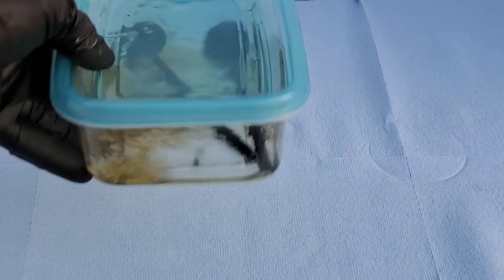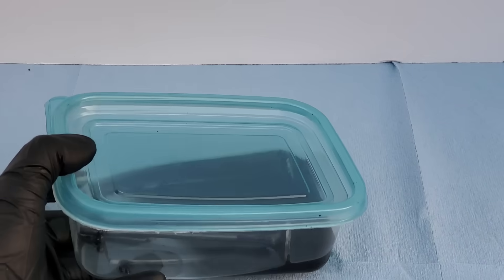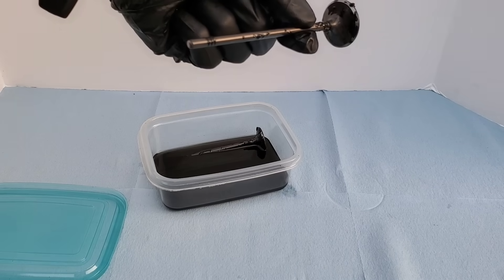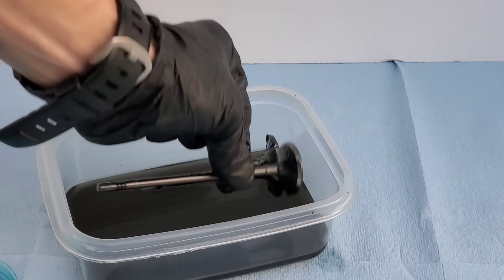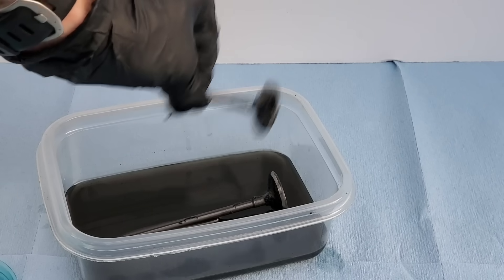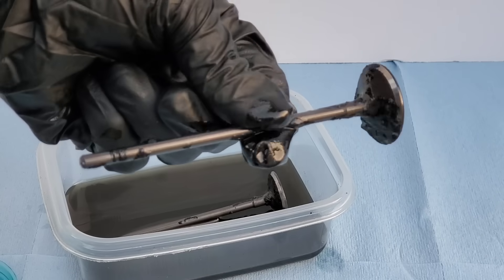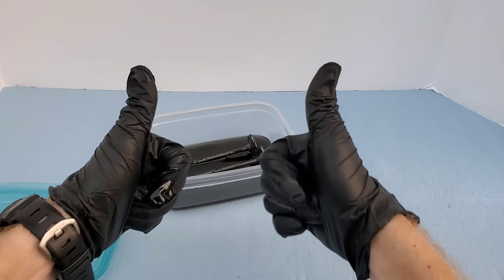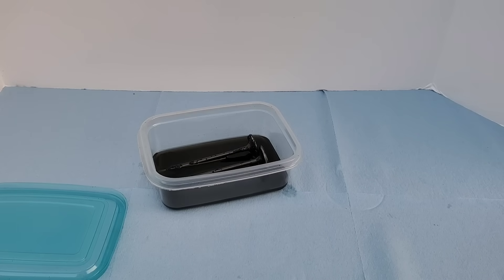I'll shake the valves up again now that they've had plenty of time to sit — I allowed it to sit for a day and placed them in the sun. Moment of truth. Oh wow — it actually did make a difference. Granted, it didn't remove everything, but for the most part — and I'm telling you, this carbon was on here bad, very thick — incredibly, it removed it. Those hard problem areas: if you wait too long, it's just going to make it even more difficult and you may have to walnut blast, but it's definitely going to help. Thanks for watching Nate's Interactive Auto.